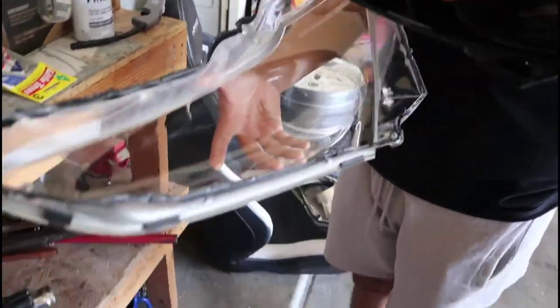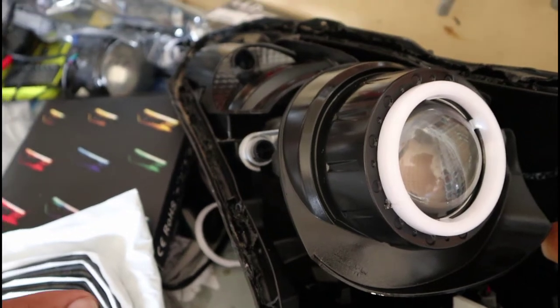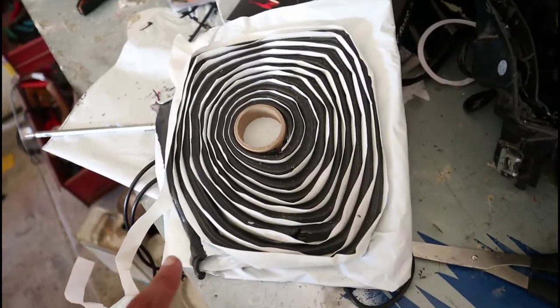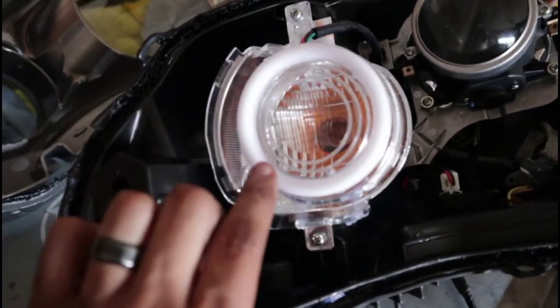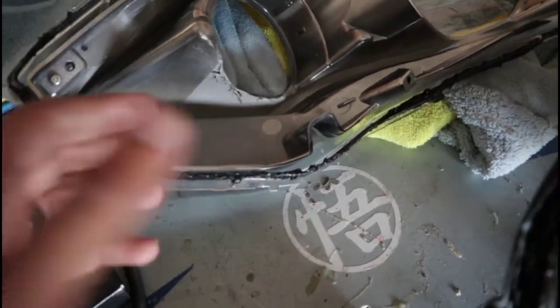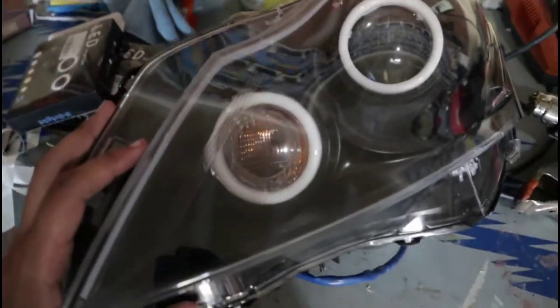Jonathan is hooking everything back up. I'm going to run the headlight sealant through the little groove — a thin layer so it squeezes back into place the way it is stock, but enough so it won't split apart. Before we close these up, we did have to make a small cut on the lower section of the headlight housing because the housing was hitting up against the halo. Take a Dremel and cut or sand it down, or shave it down with a knife, and test fit it multiple times to make sure it fully clears the halo before resealing.